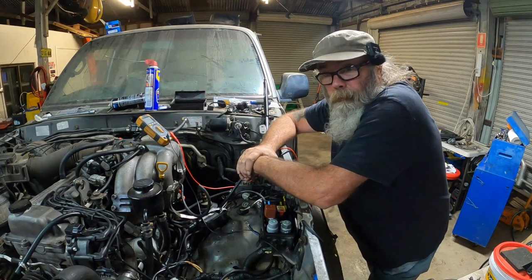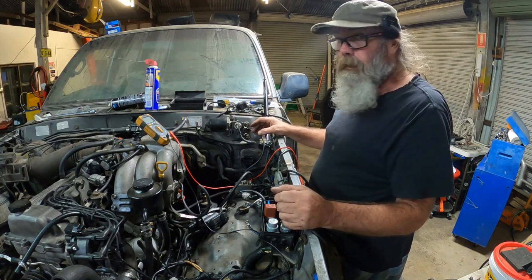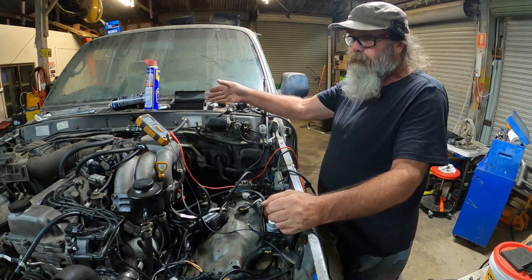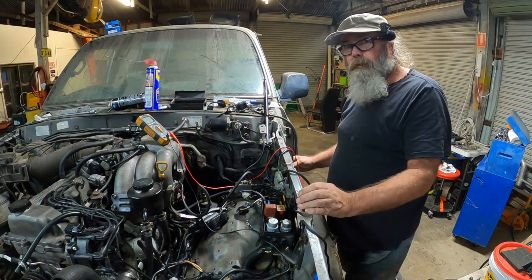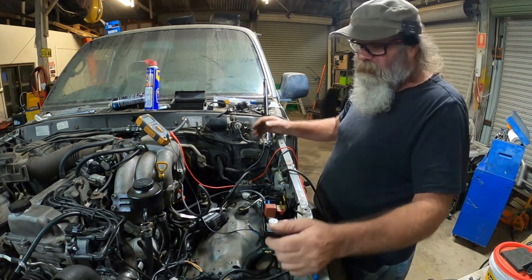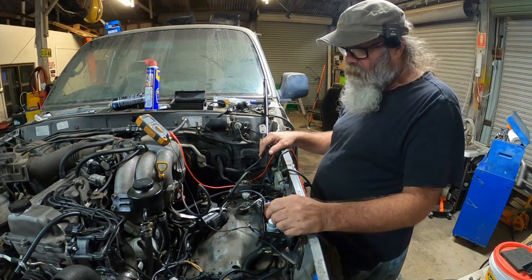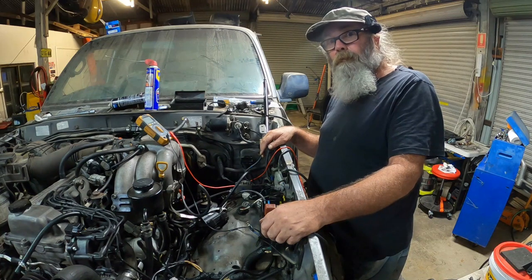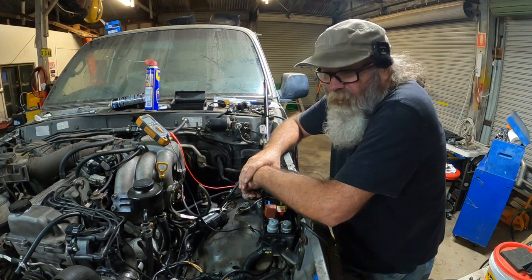As I've been editing this video, I've found that I've made some assumptions that aren't quite correct - specifically in how the power feeds to the fuel pump relay. That actually comes from the main power relay, which sits underneath the driver's side in Australia. That switches on and feeds power to here. I shouldn't be getting any direct continuity from this 50 amp fuse to the fuel pump relay plug. The next step is just to open up this section and see if I can see anything. If not, I might just have to pull the whole loom out and go over the entire loom. Chances are the short is inside the vehicle, behind the dash - which is going to be a right pain. I've had enough. Thanks for watching - don't forget to like, subscribe and comment, and maybe we'll get this thing running one of these days.